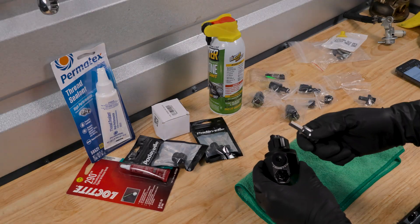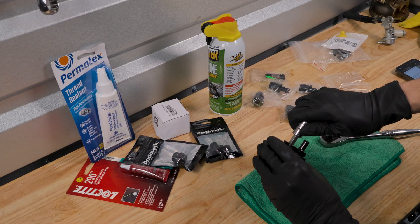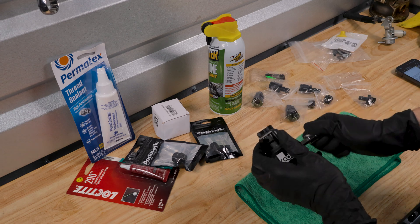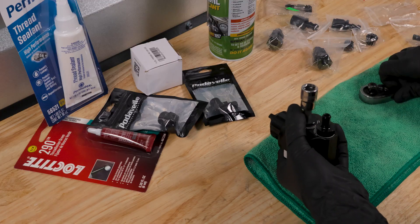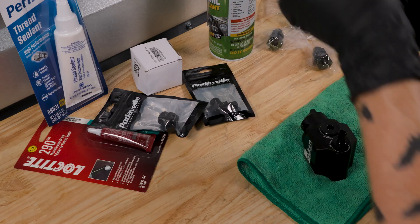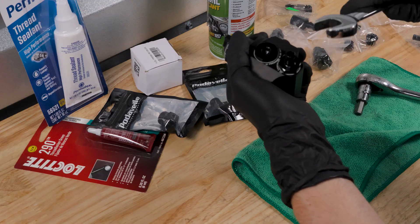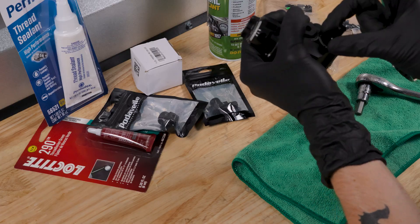I was trying to find an Allen key for the top plug — it's a 5/16th of an inch Allen key you're going to need. I'm just going to finish the rest by hand and then tighten it down via a 3/8 ratchet since that's the only thing I have, but I'm going to be very careful not to over-tighten it. Because this is an American company, we're going to have to find a standard size — just be patient. Once it's starting to feel snug, I'm going to go a little bit more and that's it, no more.